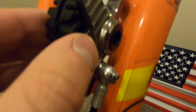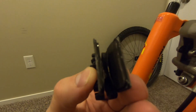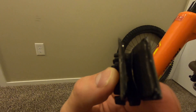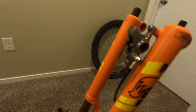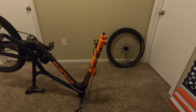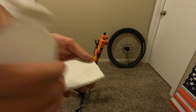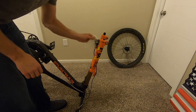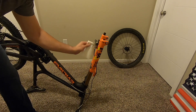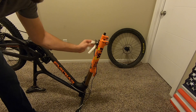It's pretty gnarly — grease it up and clean it up. Take the pads, just pull them out with the spring. See how worn they are? Pretty worn out — toss those away. Now what I like to do is take a rag, put a little IPA on there, and wipe it off to clean it up.